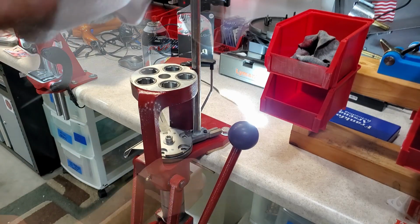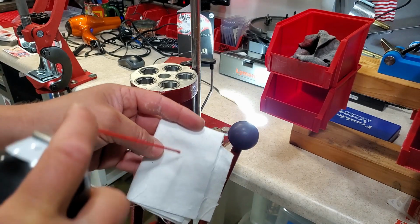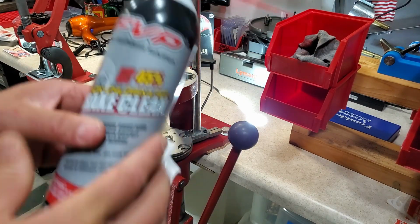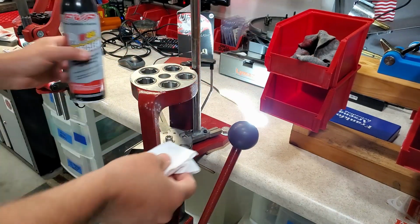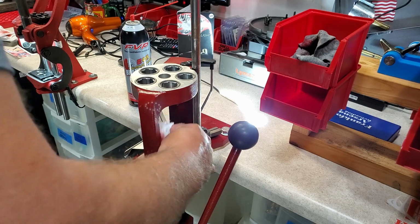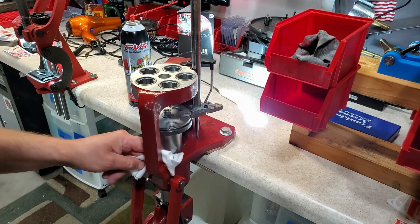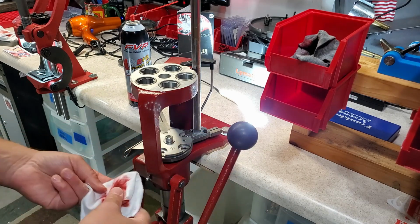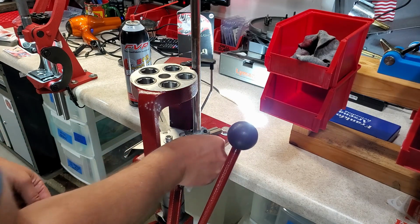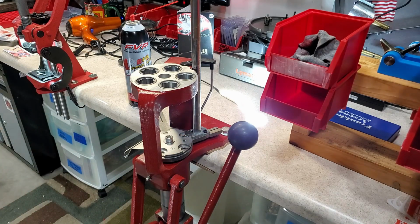going to be. Now once you've scuffed up that paint surface with the Brillo pad, grab a brand new rag with some denatured alcohol, in my case brake cleaner. You're going to just go back over that surface again. Just make sure that that surface is nice and clean. Obviously on the side where the cable management's going to be. And then make sure you let that dry.